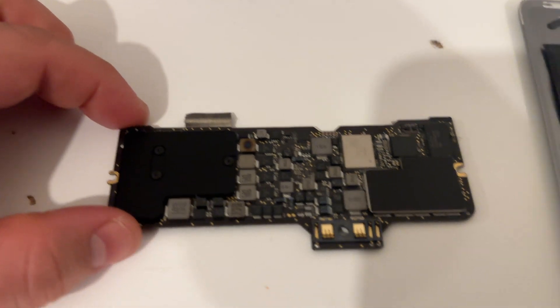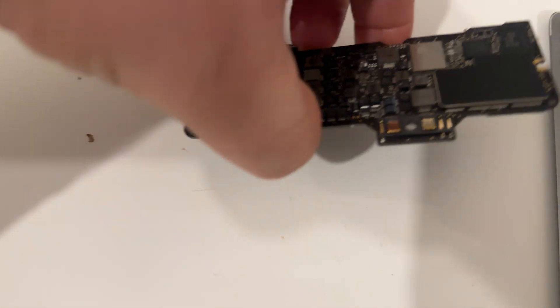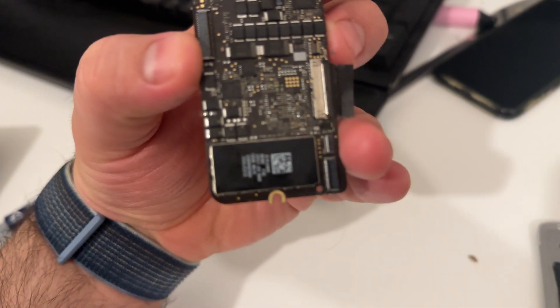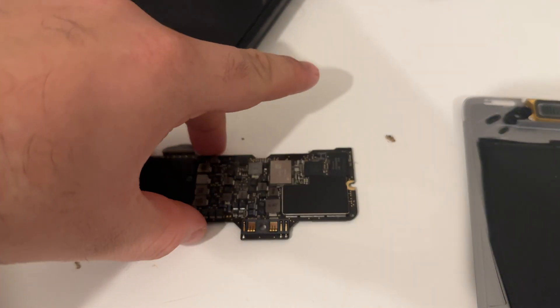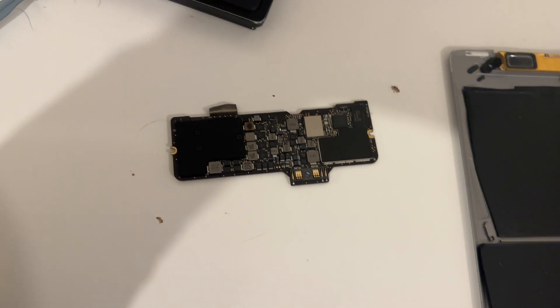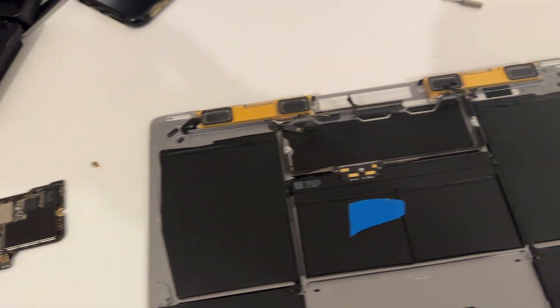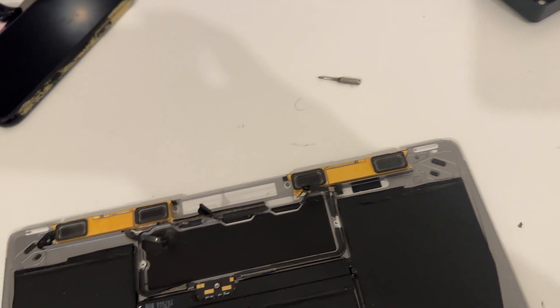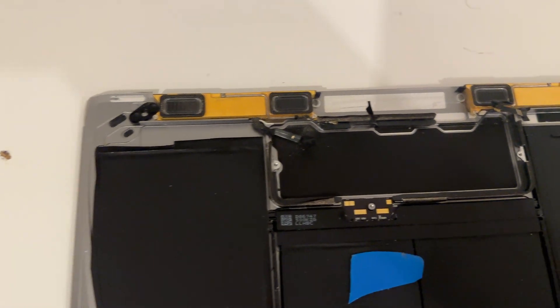That's great, however it's not ideal — because if you look underneath the heatsink, that's your SSD, and these things regularly — I've been monitoring this — regularly hit like 96 degrees while watching YouTube videos and whatnot.